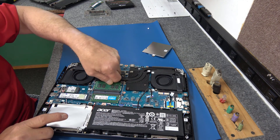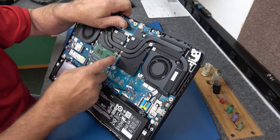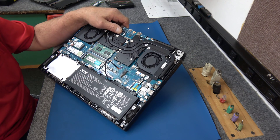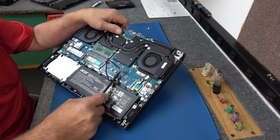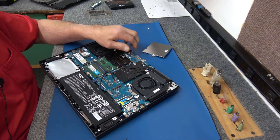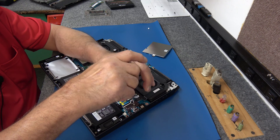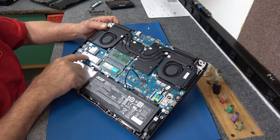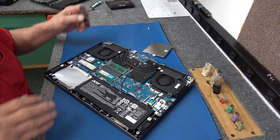Same over here. Make sure the seat is in good. We're good there. Over here is our second M.2 slot — PCI Express. There's a mounting screw that's going to kind of just float over top of all the connectors over here. Let's get the mounting screw out. We're not putting Windows on this two terabyte — that's already installed over here in the Kingston they have in there. It is a Gen 4 PCI Express; I believe the second slot is only Gen 3, but that's okay — we can still put a Gen 4 in there.